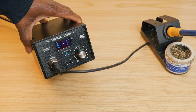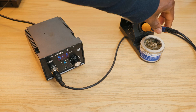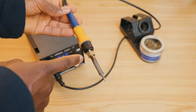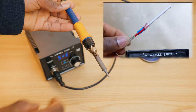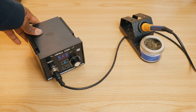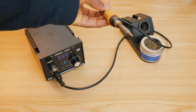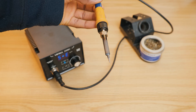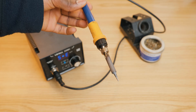As you can see it's a 5-E error, and it's basically related to the heating element being broken. The heating element is the white tube in this part right here that makes the tip heat up. To fix this you basically have two options: a cheaper option being replacing the heating element, which is going to require some soldering — so you're going to need a backup soldering iron.